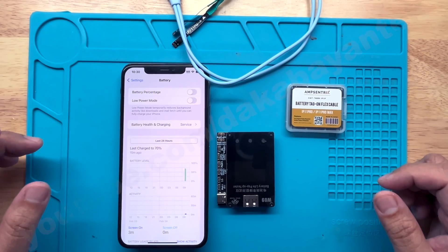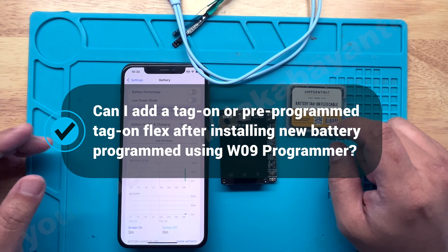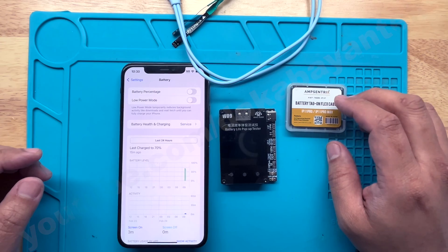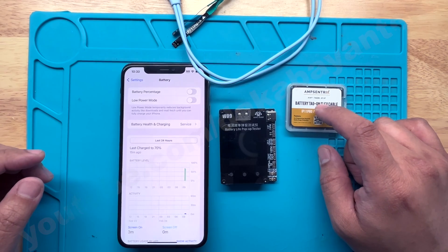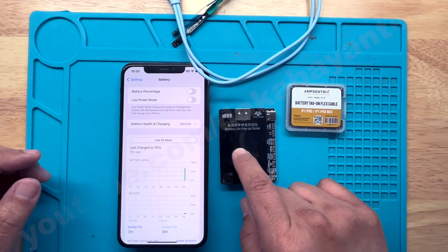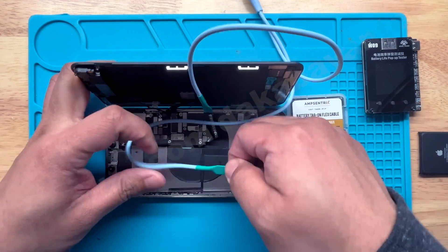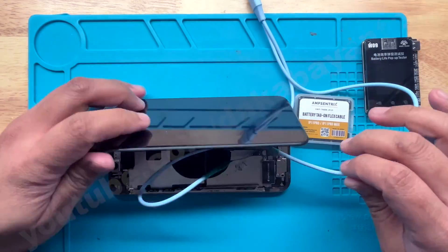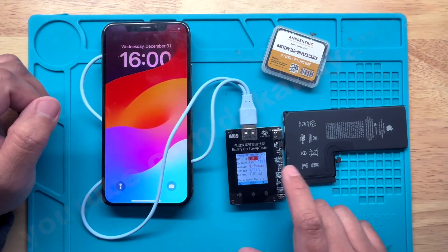Continuing from the 11 Pro Max battery replacement, another question was: can I add a tag-on or pre-programmed tag-on flex after installing a new battery programmed using the W09 Pro programmer, to avoid the original battery health coming back? Of course yes, you can — but a few caveats to keep in mind. First, purpose: my first reaction was, what for? It defeats the purpose of the W09 programmer. But as I explored the W09's capabilities, it does make sense — it defeats specific issues that may arise in the future, like a customer restoring their iPhone using 3U Tools, or when Apple triggers battery calibration similar to the iOS 14 update that affected some iPhone 11 series and above. Second, cost: using JC, Kyanli, or I2C tag-on flexes and their programmers adds more cost to a repair you already solved with the W09. Though pre-programmed tag-on flexes are available, they are still expensive compared to other brands.